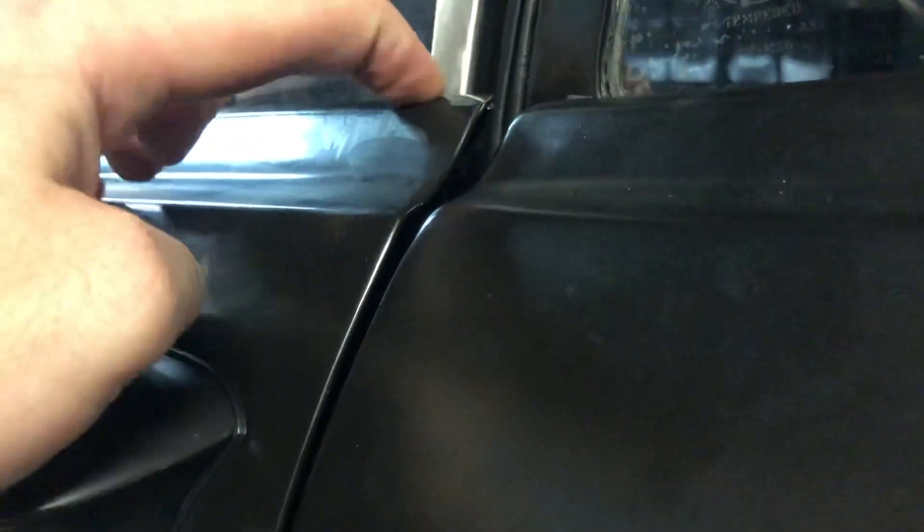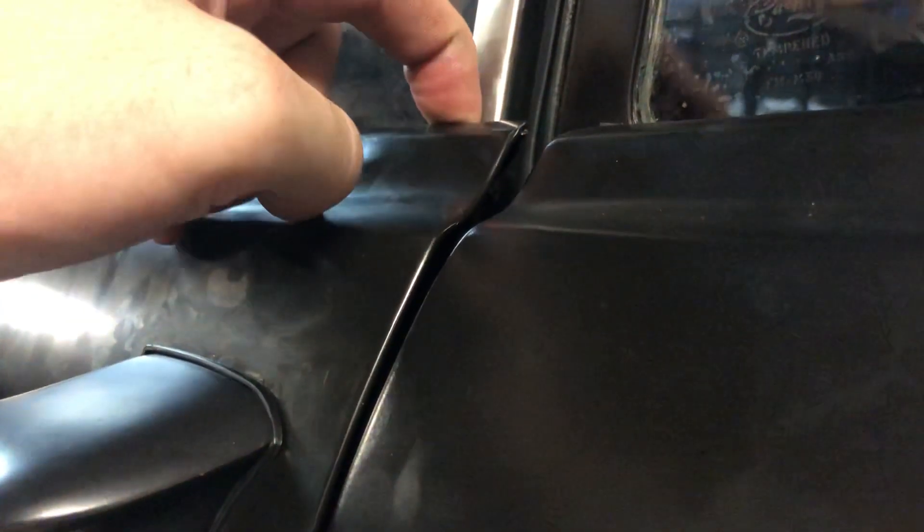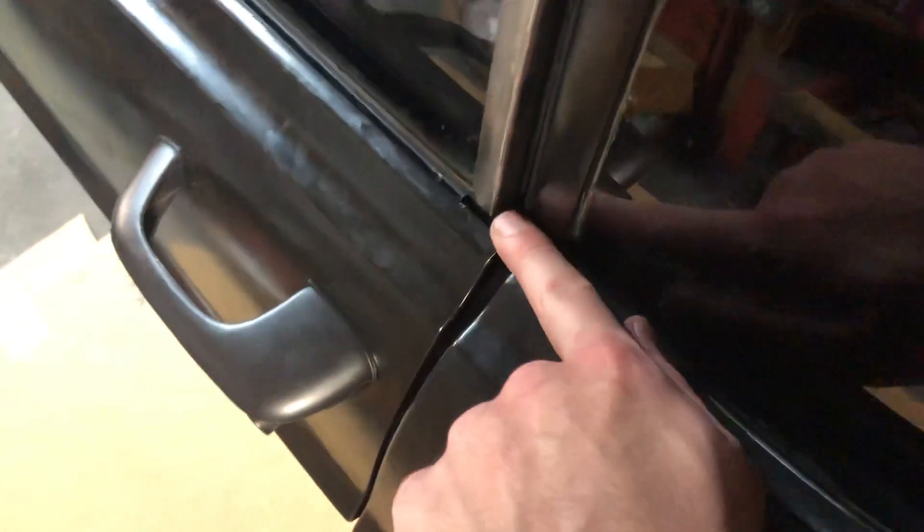This new door has the same issue as the old one — it sits high compared to the adjacent panel. The angle isn't right either; this curvature is a little bit deeper, more curve to it, while the other is more of a smooth slope. To get the same angle I'd have to knock the top down, which will probably make the window gap really tight. The inner gap is fairly good though — pretty much even all the way down.